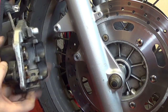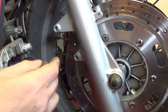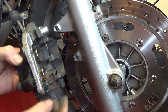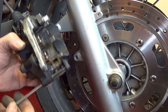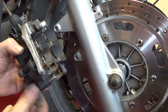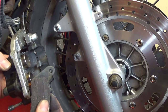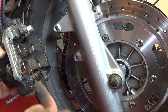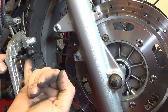And then your old pads, which are in here obviously. The point is they're inside here and they're held in by this retaining clip, and you have to remove the retaining clip using an Allen key. And once the retaining clip comes out, then you can remove the brake pads, because as I say they're held in this hole here, they won't just fall out. Then you do have some sort of sprung loaded retaining clip here, and there's one inside here, I'll show you in a second.